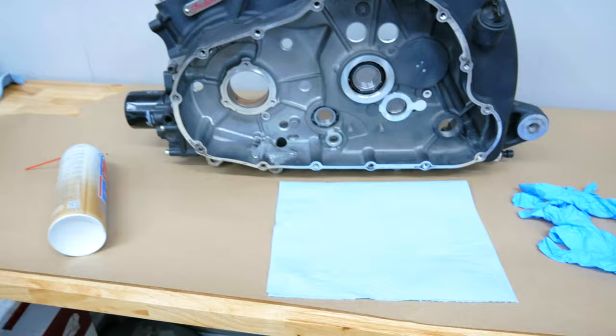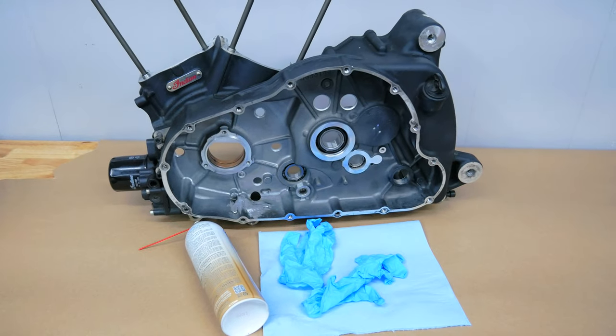I think we're good to go to start cleaning it up. So that is my plan before I put the Thunderstroke back together — clean it and keep the area somewhat clean. Let me know down below what cleaning processes you all use for aluminum blocks. That's cast aluminum — it's not steel, it's not iron — so you have to be very careful when cleaning the surface versus using something like a razor tool that could scuff it up. Let me know what you guys are doing down below. I hope these few tips, maybe the paper roll idea, helps somebody. And as always, thanks for listening to my story. If you're subscribed, I'll see you in the next one.